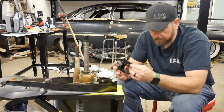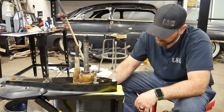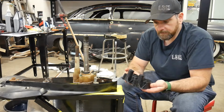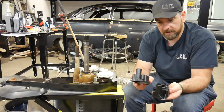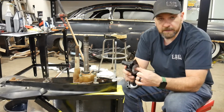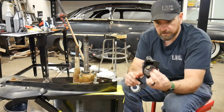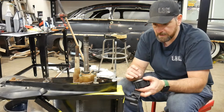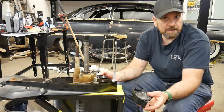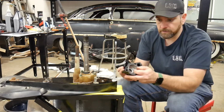The housing up here, this housing, I have a Quicksilver kit here as well, so let me show you that. So the upper housing, the plastic is just slightly different on this Quicksilver one, and you can see my stainless cup here is solid inside of there, where this one rocks around and moves. So I don't like that. I would never use that on something. I guess maybe in a pinch, but I'd almost rather just reuse the old one than use one that moved